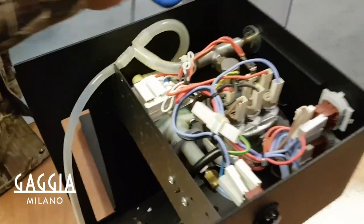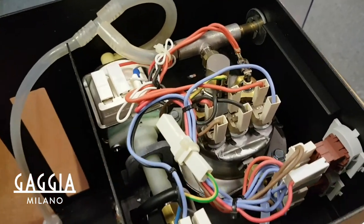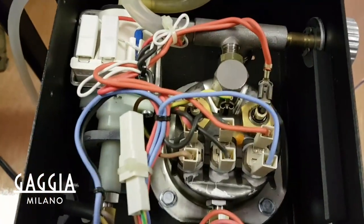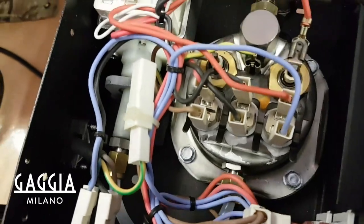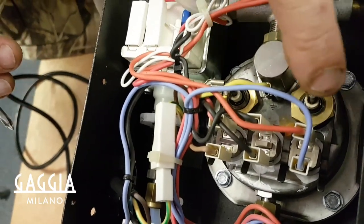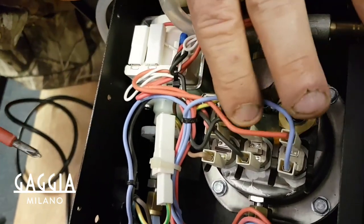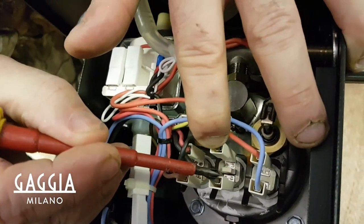This is the whole thing inside the machine. There is a boiler, there is a pump and there is a steam valve and so on. Don't get frightened. What you're looking for is a little button which is in between these two. We've got the top of the boiler and we've got three thermostats. The thermostat we're looking at is the one in the middle — that's the one with the two black wires, and right in the middle is a little button.